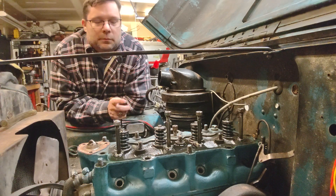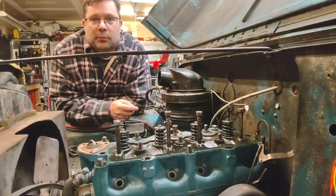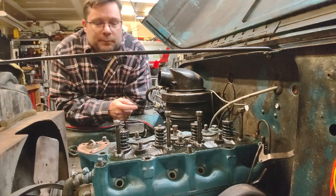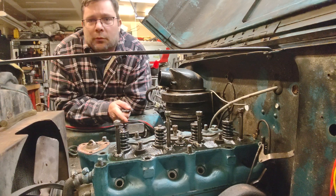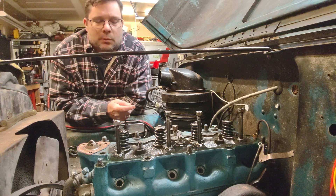I'm going to do a couple of short videos. You can see we've got the top of the motor taken apart — valve cover off, rocker arm assembly off, oil pan taken off the bottom, and some other various pieces. We were talking about this motor before; it's not running right. We originally thought the cam-to-crankshaft gears were mismatched and not meshed correctly.